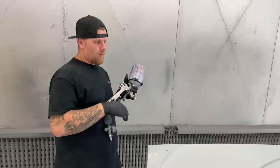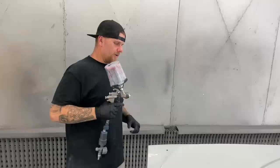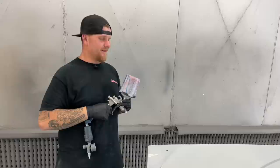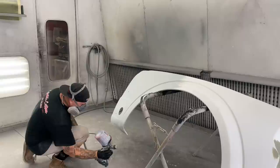Everything on the back of the panel is already 600 grit, and once this completely dries in our three-day period we can wet sand the whole panel out. You're trying to get it as smooth as you can right out of the gate so you have less to sand out. Make sure to wear a mask with this stuff and have good ventilation. If you're in a garage, put a fan going outside and make sure you're using the charcoal filters, not just a dust filter. This stuff is not good for your health or your eyes. We're going to get the booth fired up and show you guys some passes.